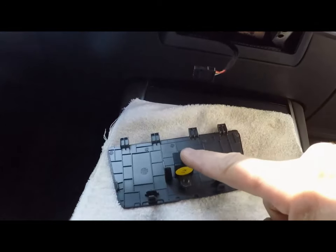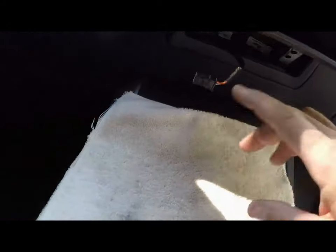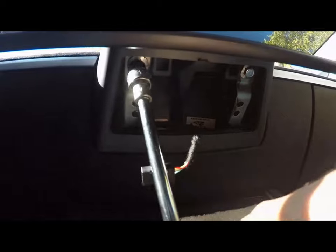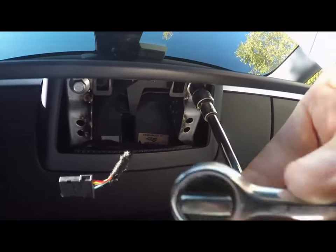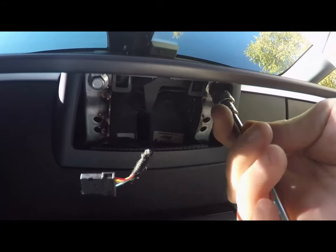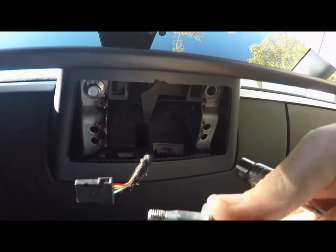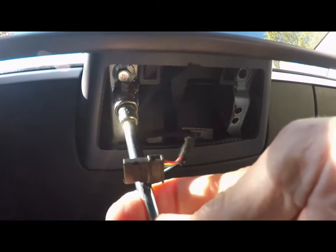Now this is free. We're going to remove this temperature sensor and install it in the new soft shroud with the kit. We'll set this aside and go ahead and remove these 10-millimeter hexagonal screws. I've got my socket with my socket extension — it's 10 millimeters. You crack those loose, then take the ratchet off the extension and use the extension to spin them free. Bear with me — I'm multitasking, holding the camera and doing this at the same time.